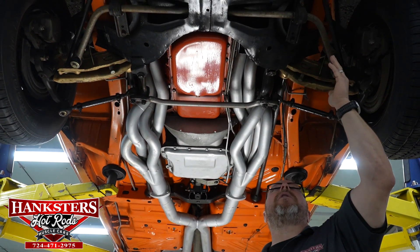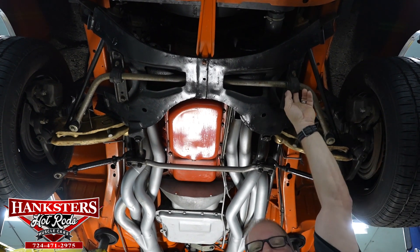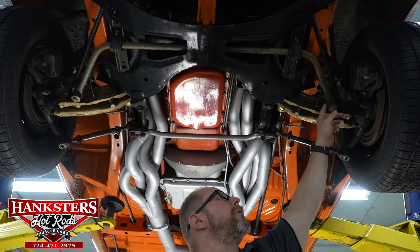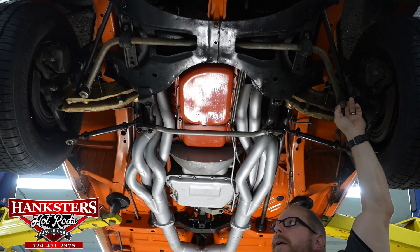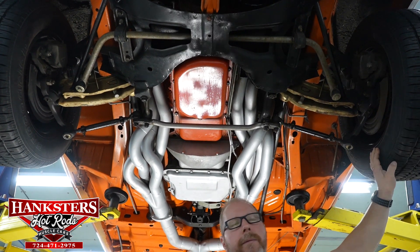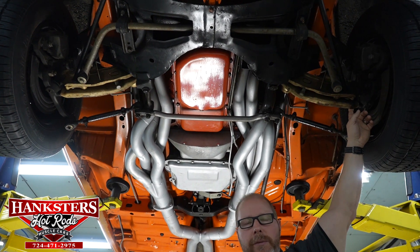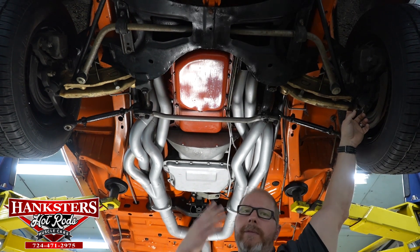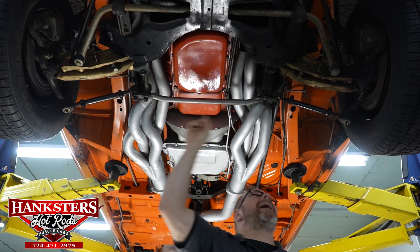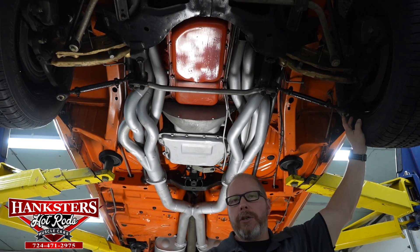It also has the front sway bar — looks to be about a three-quarter inch front sway bar — your bushings at the frame as well as your sway bar end links are all in really good shape. No splits or cracks, none of it's dried out — that's going to keep the front end nice and tight. The ball joints on these control arms are all in good condition as well. Steering components on the car — we've got power steering. We can check things like our pitman arm, the drag link, tie rods and tie rod ends — all that stuff checks out here. Ball joints on your tie rod ends are all in good shape, everything's been greased and maintained on a regular basis, and it all has the rubber dust boot covers on them to help protect those.